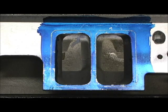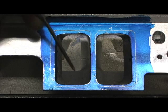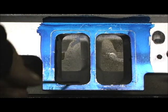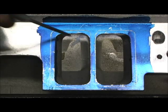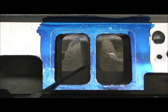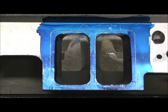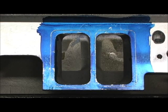This is the single reason why on most aftermarket heads — double hump heads or any of them — no matter what CNC program they're running, because that hump is in the way or they haven't put the tube in, I'm going to have a 10 to 20 CFM advantage. These companies won't purposely break through and put a tube because that's a machining process — they're all about getting it in and out fast. Human hands would have to be involved; they can't automatically put epoxy in and install the tube.